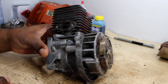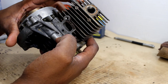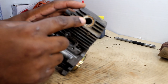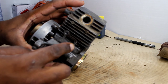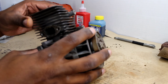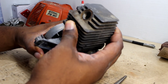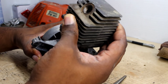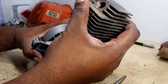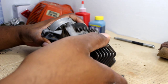Now we can remove our head. This is the exhaust side right here and this is the intake side. You can always tell on this FS80S — the spark plug is always facing the intake side on the FS80S. Now we're just going to remove our head off of this unit. All you have to do is pull it straight up. It's kind of caught on the ring but we got it out of there.